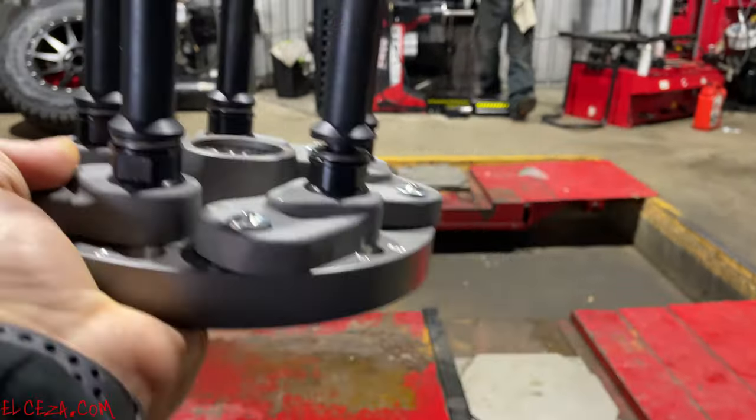However, you don't have the big stereo system in here, but you've got your earpods, and you jam into the beat, do this while it's spinning. You're introducing a little bit of vibration into the balancer, and again, we're chasing a quarter of an ounce of weight. Don't do that, okay? Your best bet is to put your thumbs in your pockets. Anytime the balancer is spinning, don't touch it.